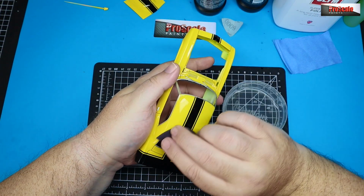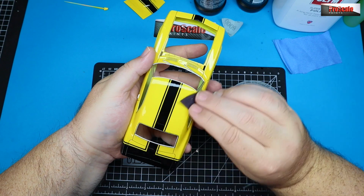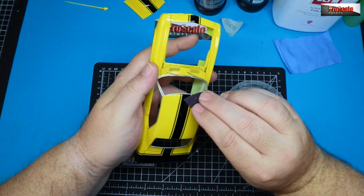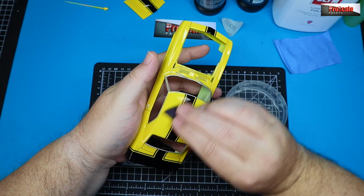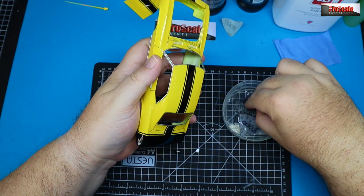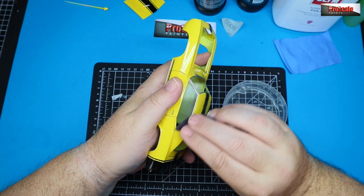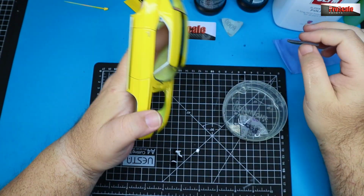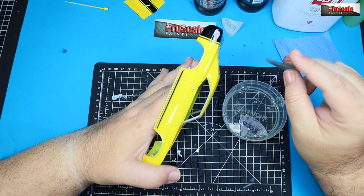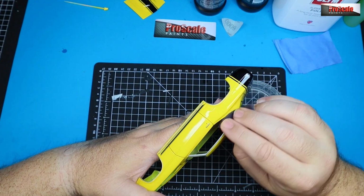5 to 7 days is optimal for sanding. It just makes it sand a lot easier. While it's touch dry in 4 hours, it does take a little bit longer to fully cure, but it's by far faster than other clear coats. I've used lacquer clear coats before that take weeks to fully dry, and while it may feel dry, it's noticeable when sanding and polishing because the scratches are hard to remove. Because the clear coat's not fully dry, it's very hard to remove the scratches.